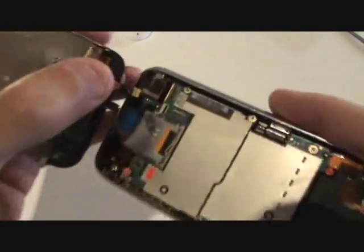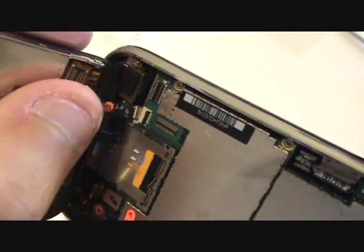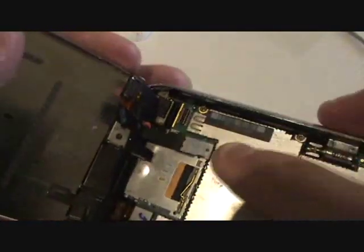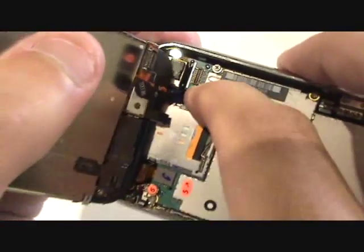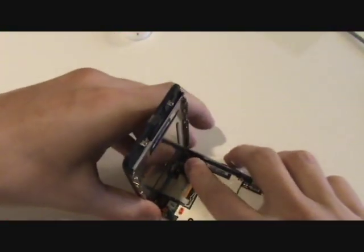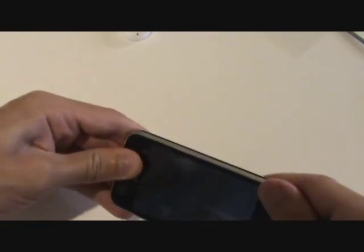Now the first one is going to be the hardest — cable three. It is small and you have to get it bent at the right angle so that it will slide in easy. Once you have it in the port, flip the black latch back down in place. Now go ahead and press the front glass and digitizer cable back into its place — don't force it, just get it in the right position and it should clip right back on. For the final one, we are going to have to set the phone down and bend it at a slight angle in order to get that cable on there. Once we have all three in place, you can close the front assembly and make sure it is flush with the rest of the phone.